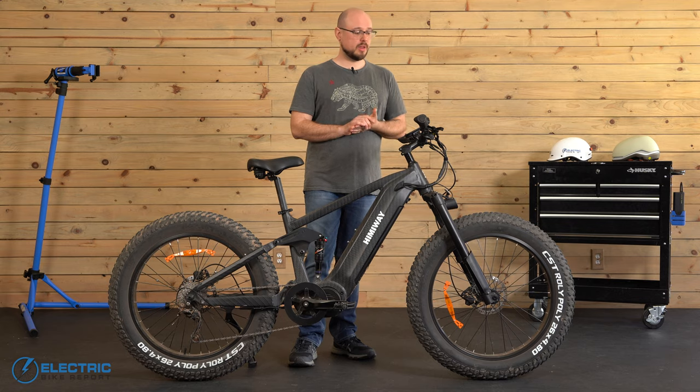I mentioned before the Cobra Pro's weight, and you can definitely feel those 88 pounds when you're doing all the work, although it felt a bit easier here than with some other bikes I've tested. This is most likely because the placement of the mid-drive motor keeps the weight of the bike pretty balanced. You're not going to want to pedal the bike without help from the motor, but it is possible. You'll see in the data that we saw a 6 mph increase in average speed in Eco mode and PAS 1. This is pretty uncommon, but it goes to show that the Cobra Pro is delivering quite a bit of power even at its lowest setting.